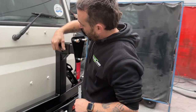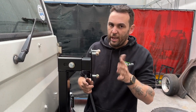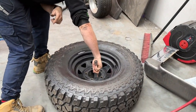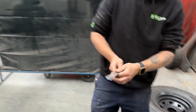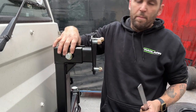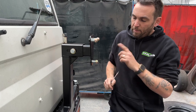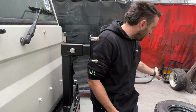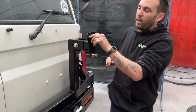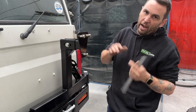For the wheel plate, put your M16 bolts in. The distance here needs to be about 10mm less than the backspace of your wheel — put your wheel flat on the ground, measure through (say 145mm), then set this to 10mm less (135mm) and do them up super tight. The idea is that the tire will have crush on here and stop these rattling loose. For steel wheels, turn the nuts around and run them like a normal wheel nut. For factory alloys with the big hole, run the nut backwards with the supplied washer. That way you can swap between wheels and one set of nuts will still work.